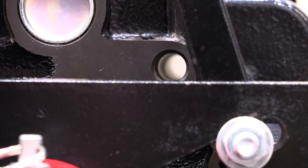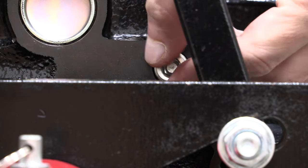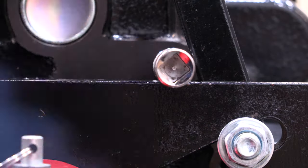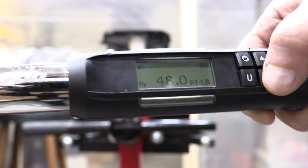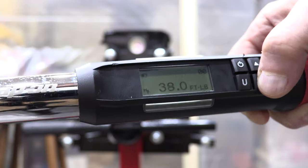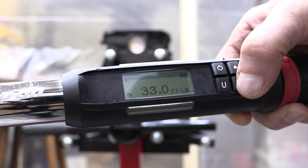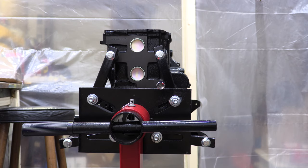But before we get headlong into that, the main oil gallery plug seems simple enough to take care of first because I already have the wrench, the socket, and the plug. But there's no torque specification anywhere in the service manual for it. Not that I can find. I looked around online and I found a stat for a 3/8 inch BSPT carbon steel plug at 48 foot-pounds. But mine is zinc coated. I found BSPT pipe listed at 40 pounds. I found zinc coated fittings that required 3/4 to 1 3/4 turns from finger tight. But this plug has thread locker on it, and that'll have a major impact on how far it finger tights. The highest torque rating I can find for anything 3/8 inch BSPT in the 2G service manual is a block coolant fitting at 33 foot pounds, not a steel plug.